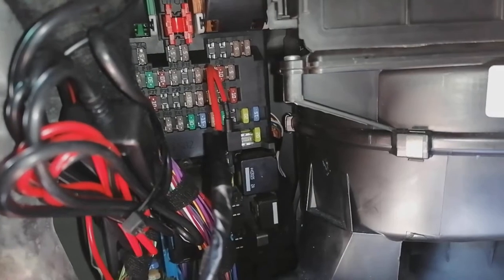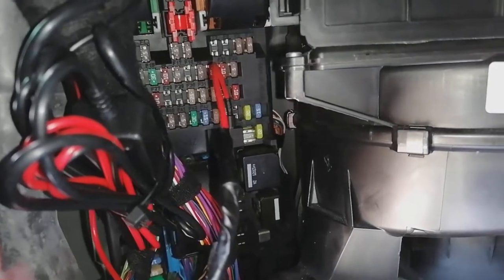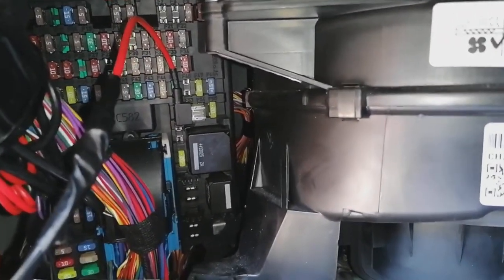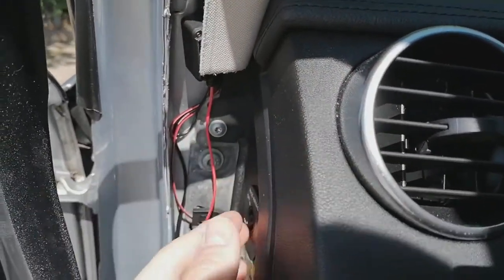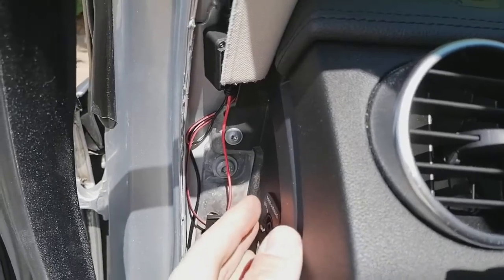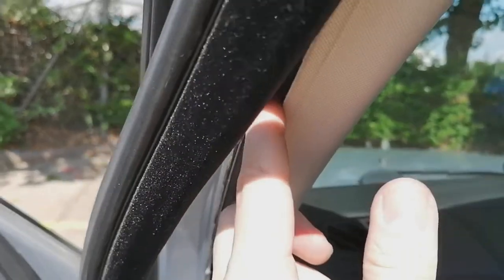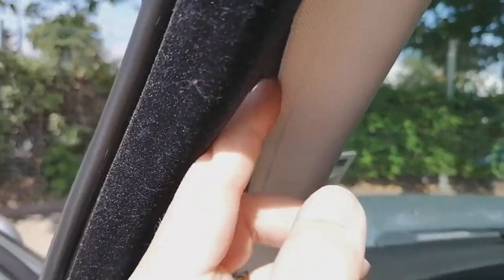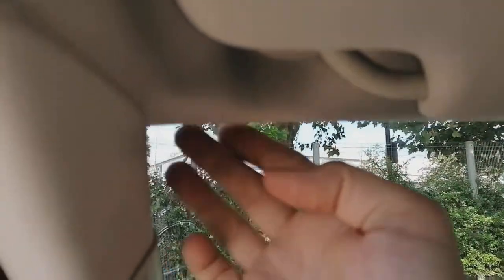Next up, we're going to run the cable to the driver's side of the car where the Road Angel is situated. I chose to run the power cable upwards — you can go down and through the middle of the center console, but the cable on this vehicle was long enough to go up and over. We've run it up the side of the screen pillar here, then popped it behind the airbag that sits in there, and then it runs along the top of the windscreen all the way along until we drop down to the driver's side.